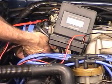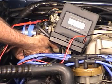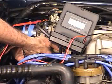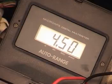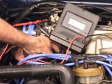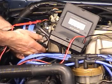I want to see a smooth transition from this 1 volt position up to approximately 4.5 volts at wide open throttle. Slowly moving it — I've got 1.4, 1.8, 2 volts, 2.8, 3.1, 3.5, and I think I have it at wide open throttle and it's 4.50. I saw a steady climb of the voltage — that's very good. Going back to the stop idle position and I'm back at 1.02 volts. That's perfect.